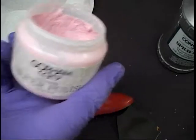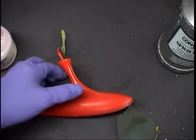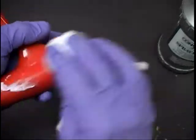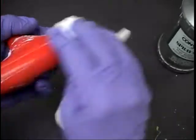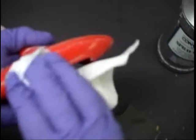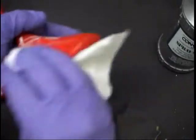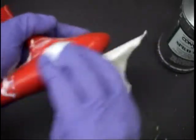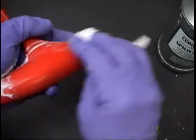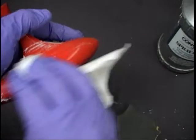our old friend Gorham's. What else could there be but Gorham's? And again, there's a lot of other materials, Finesse-it, everybody, different compounds in the 2,000 to 3,000 grit range. I don't know what Gorham's is. I've heard it's 2,000, but it may be 2,500. And this is going to be a matter of maybe 5 or 10 minutes. I can be watching TV while I'm doing it. I don't need to really pay attention, because I've got enough material on here that I really shouldn't go through.